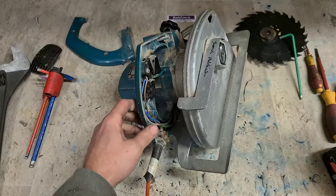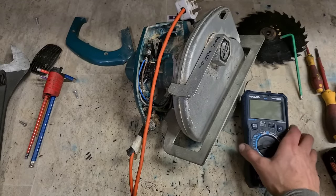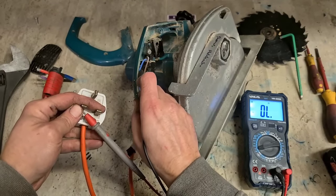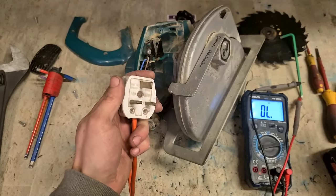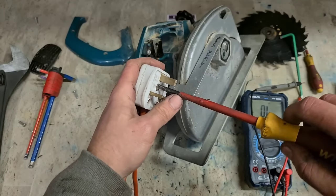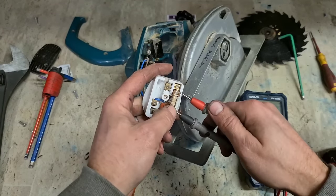A very small switch. Not have one of them. Check the lead here. Hopefully that's the problem. Looks like it. Have neutral, not live. Just in case. I'll check the fuse. Doesn't seem like that was open before. Maybe he didn't check the fuse. No, fuse is okay.